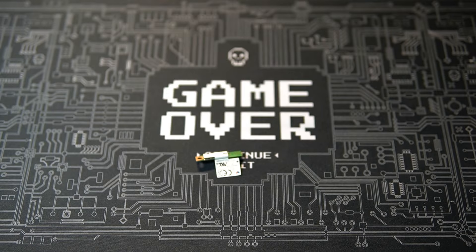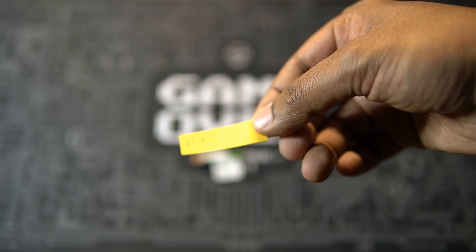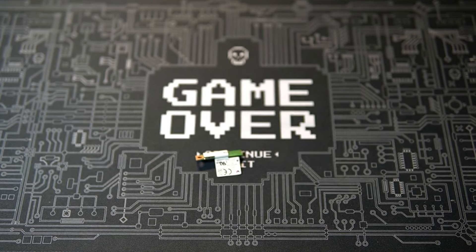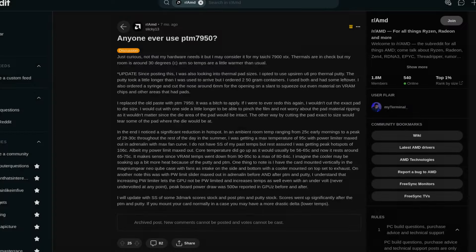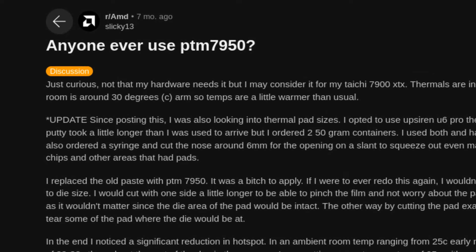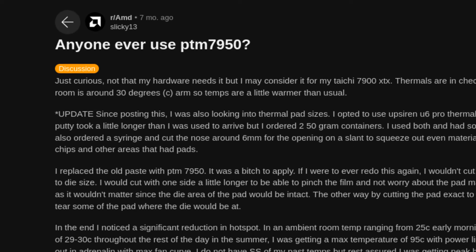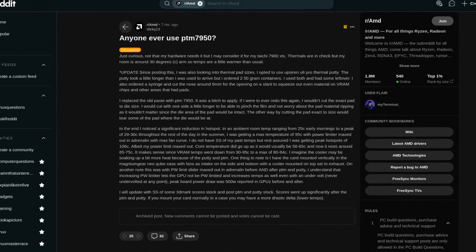There was an obvious obligatory step of replacing the thermal paste, which is not an easy job on this machine compared to some other ThinkPads I've done it on. I did remember being able to successfully use the PTM7950 on one of my ThinkPads, and if I remember correctly, it was the X220 that received it.